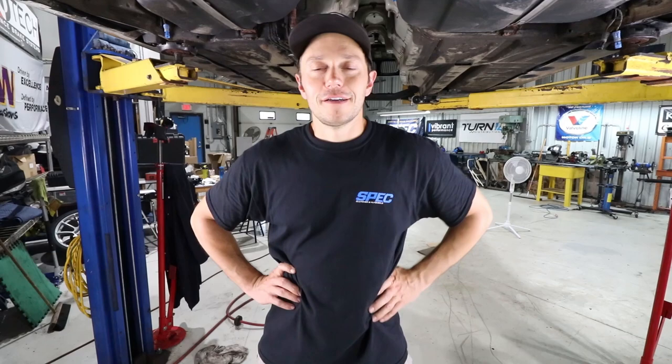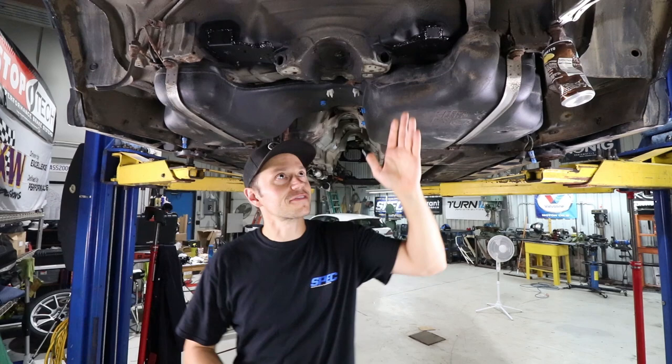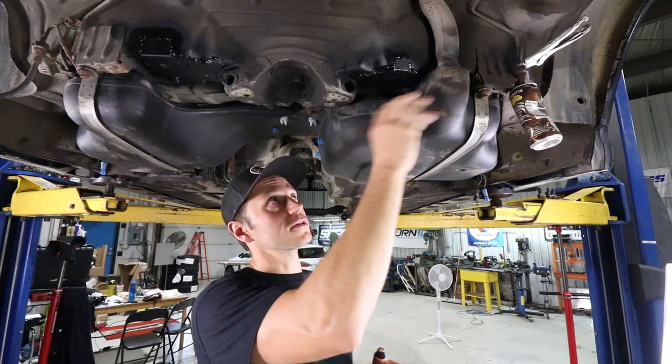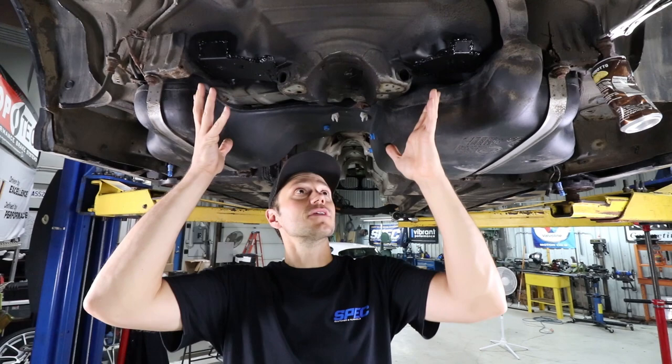And what was about 30 to 40 seconds of time-lapse video took about, I'd say, 3+ hours to do. There's a lot of manual labor in this. However, we do have these plates in place now. What you saw was I prepped the surfaces, then kind of spot welded the plates on. Then I ran seam sealer all the way around the edges and painted them with a rust encapsulator at the end here. So they are sealed in place.